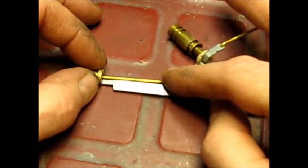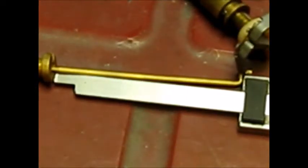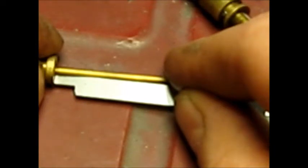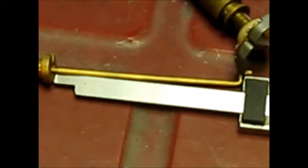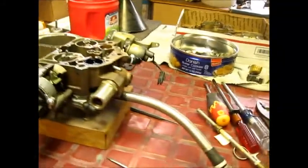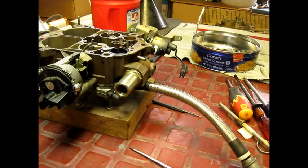It's really a little bit more than 20 thousandths but there's a lot of room. As I hold this against the vernier and adjust and tighten the jet, you can just see it. Record that measurement. I have one inch and roughly 36 to 37 thousandths.